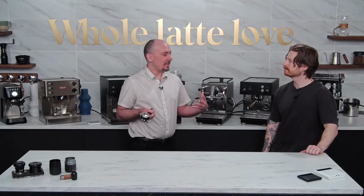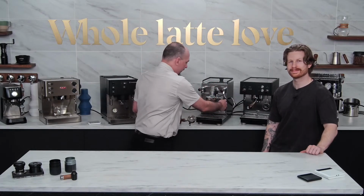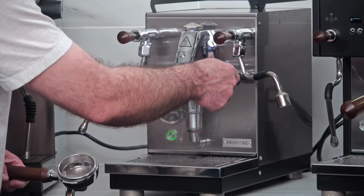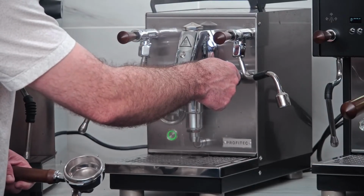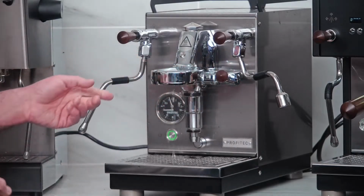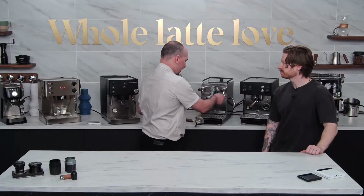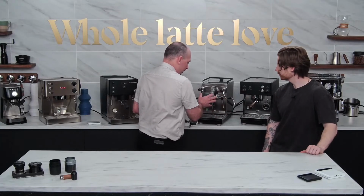Now, if you're watching and you're wondering what that was, that's basically we have a little too much steam. It's a little too hot inside the heat exchange tube. Even on a machine that has any kind of PID regulation, if you have it sitting for a while, you will want to run a cooling flush because that's also going to affect our pre-infusion, as you can see, because there's more pressure that's allowing that water to be pushed out. So now that we've cooled things off,